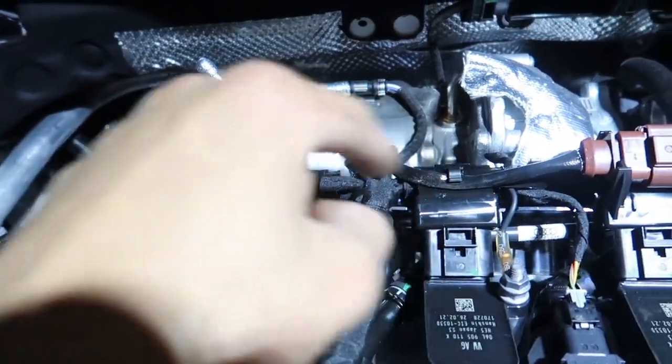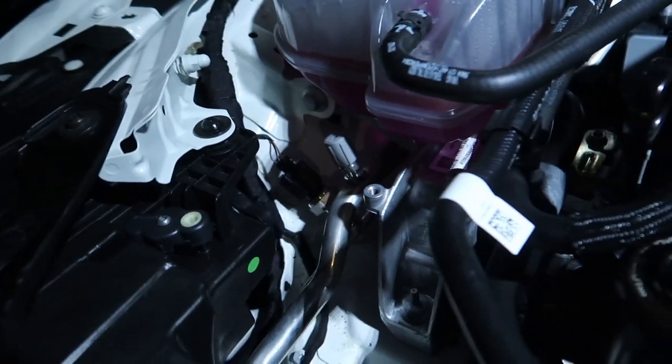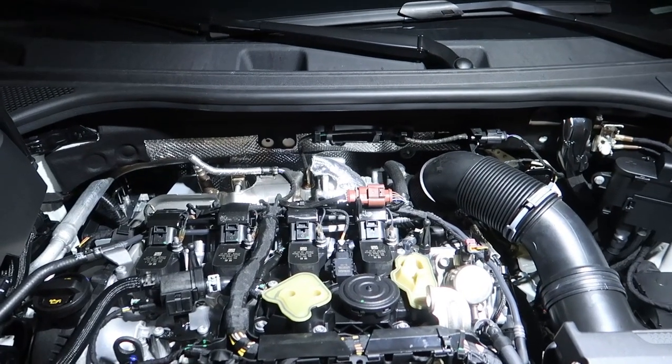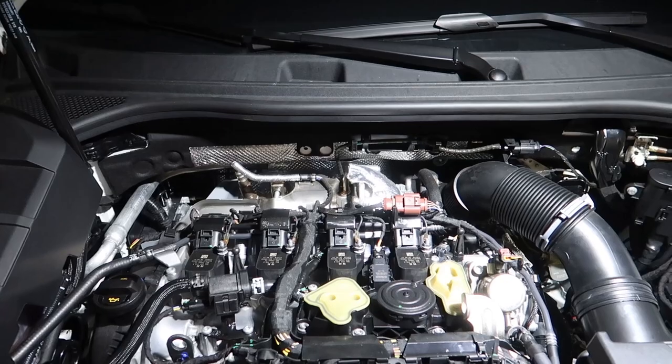Let me know what you guys think. We still got the EQT grounding kit that needs to go in — it gets rid of all these ugly grounds on the coil packs. You get in deep, put the new pins in, and then there'll be a wire that hangs out and you throw it to a chassis ground over here. There's one right there — boom, chassis ground. So we'll do that sometime this week. I need to borrow a de-pinner, it's a very simple process. Anyway, that's all I got — hope you guys like the video. Make sure you drop a thumbs up and let me know if there's anything specific you guys want to see. Thanks for watching, I'll catch you on the next one.